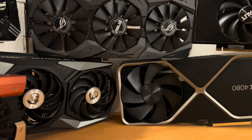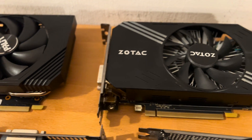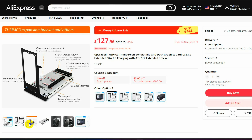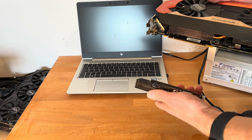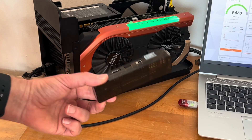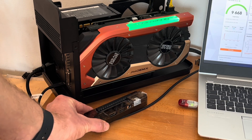You definitely pay for performance that you cannot use. But if you still have an old graphics card or laptop or even both, you can set up a cheap second gaming system. The USB-C module is a great option, works pretty well, and can be found used from Razer for around $200. There are also no-name USB-C devices from Alibaba for around $130 but without a power supply — I don't know how well they work, but they might be an option. If you want to save even more money and graphics quality isn't critical, you can use the EXP GDC module with a GTX 1060 or 1070. The GDC module costs around $30 to $60 depending on connection type, and a used GTX 1070 costs less than $100.